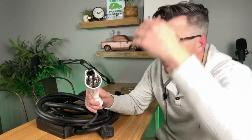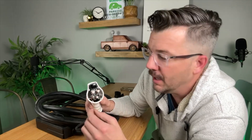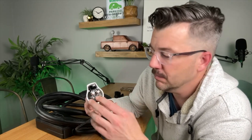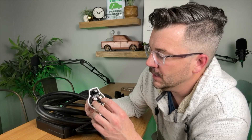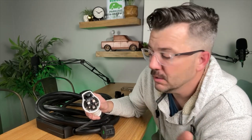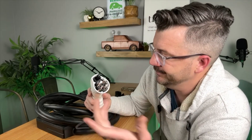I did a little bit of research — this is going to show you how much I don't really know about these things. This is a typical J1772; I took the front of it off. So these are Line 1 and Line 2 — basically 120 volts coming through each one. So when it's plugged into 240, it takes both those lines and adds them up. And then this is the ground. And then these are the proximity detector and the pilot — basically they communicate to the car and the onboard charger, telling it when you're pulling it out so it can disconnect the power. That's my understanding of it. If you know more about what these specifically do, please put that in the comments below.